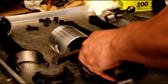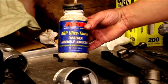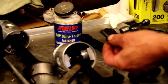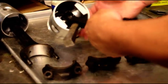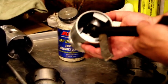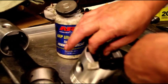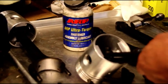Now we're ready to put our bolt in. On your bolt, use a little bit of ARP ultra torque. That is your pinch bolt — a lot of times these are not in good shape because guys don't get the pin in the right orientation. With that wedge in there you can move things around and get it adjusted. You should be able to thread that in by hand; if you're really forcing it with a wrench you're going to ruin the threads. Thread it by hand, take your wedge out, then get your wrench on there and finish it the rest of the way.